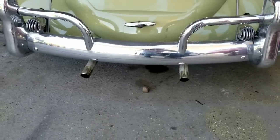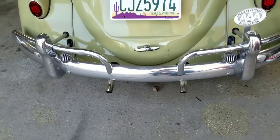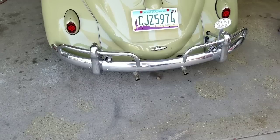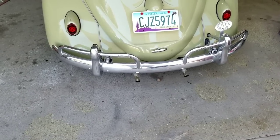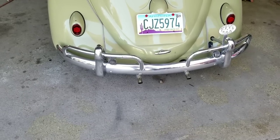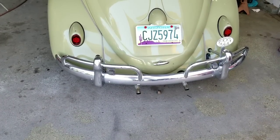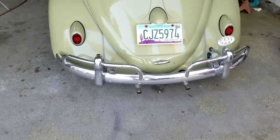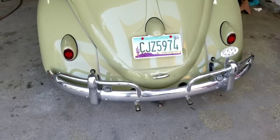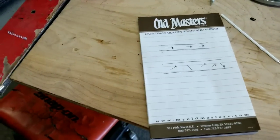That's how that sounds — it's a little louder and a little rattier, but it still sounds kind of cool. If you want the 36-horse and you just want to get a little more juice out of it, straight pipe it and then make sure you redo your jetting accordingly because it's going to let you pick up a size, and that's how I got a little more power out of this thing.